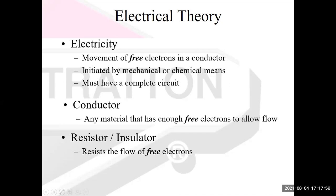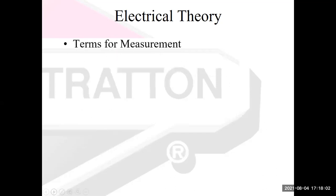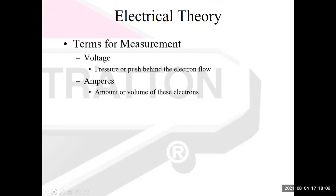So if I keep this presentation moving forward here, we've talked about voltage, the electrical pressure that causes stuff to move. We've talked about current flow. Now, current flow is actually measured in amperes, or amps. So I'm going to use my annotation tool and write current flow. So current flow is measured in amps. And it's the actual movement or volume, that flow volume of electrons from one atom to another to another.